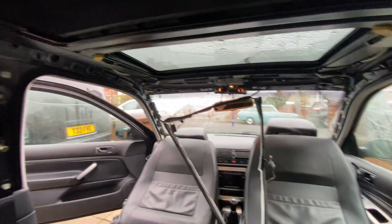I've gone ahead and removed that plastic cover that was covering up that rail - quite easy to take off. It has two poppers at the front which line up into those holes. I could go ahead and take the sunroof out now - there are three Torx screws, I think T25s or maybe T30s. Again, you can see there's a lot more of that thick grease all along there. Thick grease is definitely not what you want on your sunroof, which is why it might have been clogging it up and stopping the sunroof from functioning properly.